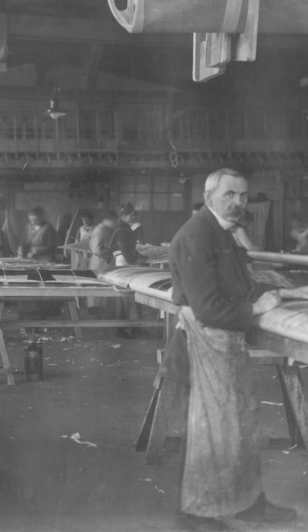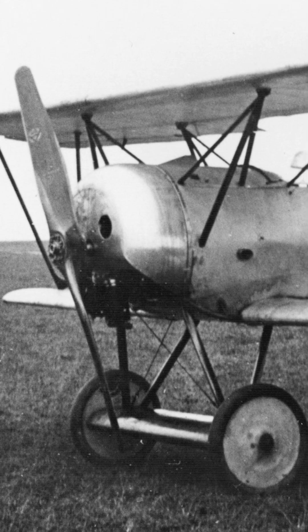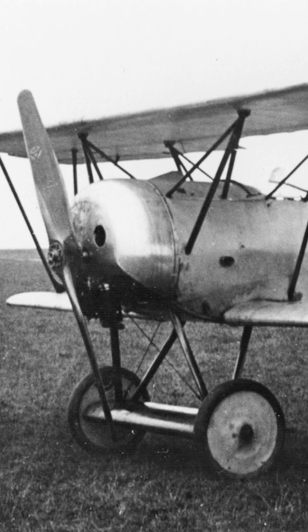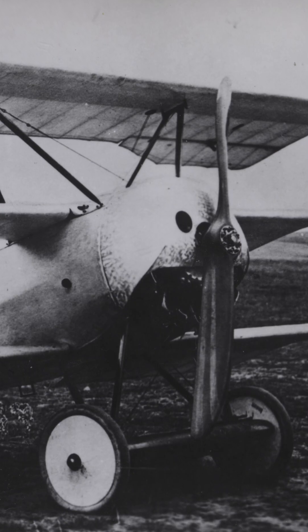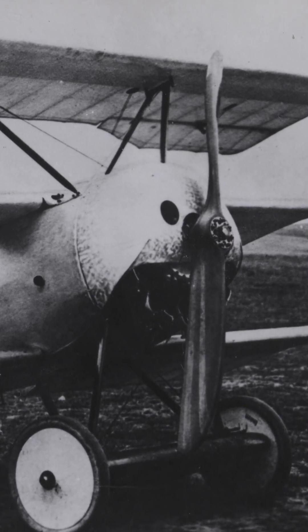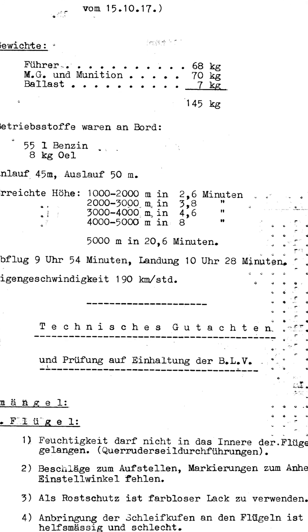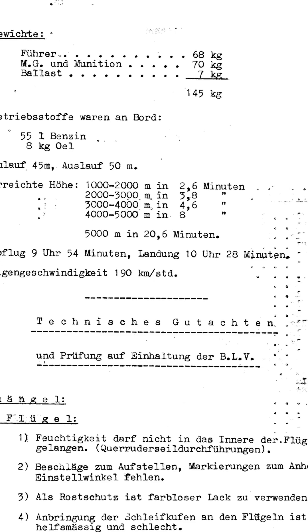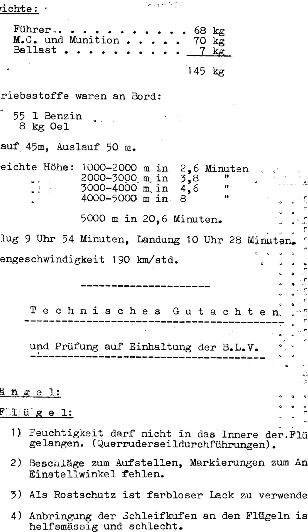What many people don't realize is that the triplane was originally designed as a biplane, later entering production as such — the D6. It was converted into a triplane during construction of the prototype, and therefore several structural features were extremely unfavorable for assembly and maintenance, because they weren't planned that way. The undercarriage, for example, could only be taken off with the lower wing removed first, despite the angled ribs at the wing root, and the center wing front attachment bolts were inaccessible.